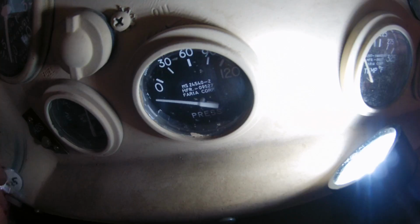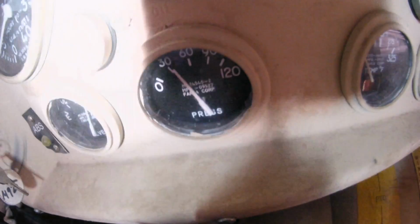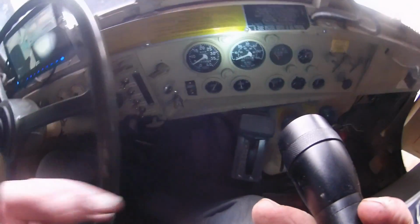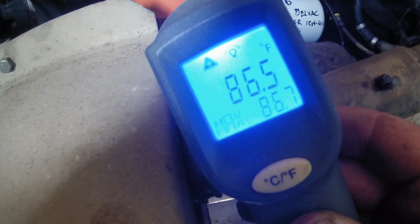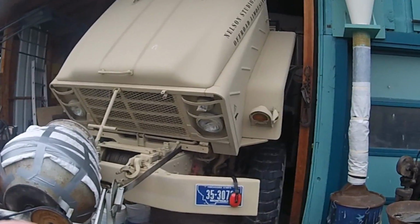Okay, I saw the needle twitch. Here we go. We had oil pressure immediately upon starting. Cold and unhappy, but she's running. I'll know if we're backfeeding through the oil auxiliary pump if those lines get warm. They should get warm right away as the motor heats the oil if I'm backfeeding. If not, if they stay cold, then I know that that check valve is working, and there's no reason to believe it shouldn't work.